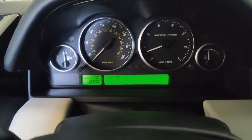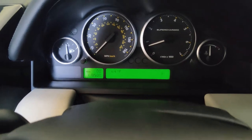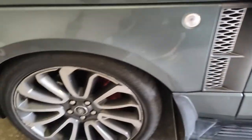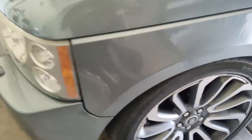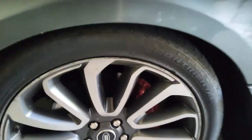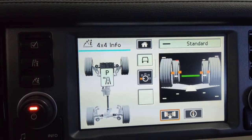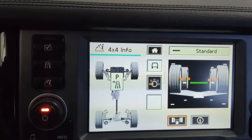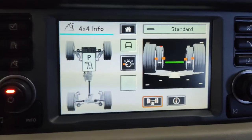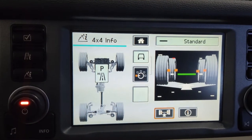Welcome back to the channel. Here we're looking at the L322 — it looks like we have an issue with the suspension. As you can see, the vehicle is sitting quite a bit lower. The vehicle is running but I can hear an air leak hissing sound out of the left front wheel. On our 4x4 info screen, the front end is refusing to raise, and the red flashing indicator shows the left front wheel — that's where the hissing noise is coming from, which is an air leak.